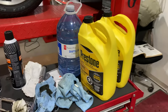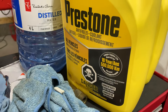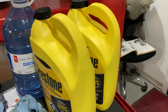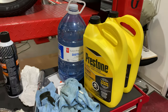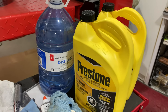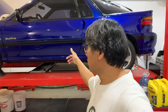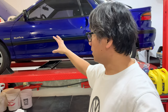Here's our coolant. It's an ethylene glycol based antifreeze. It's a GM based product basically, and we have 2 gallons and another 4 liters, about 4 liters of distilled water. It is not recommended, or it's not needed to have distilled water, but I'm gonna use distilled water anyways. So anyways, guys, we are going to refill our coolant here, and we'll do the slow process